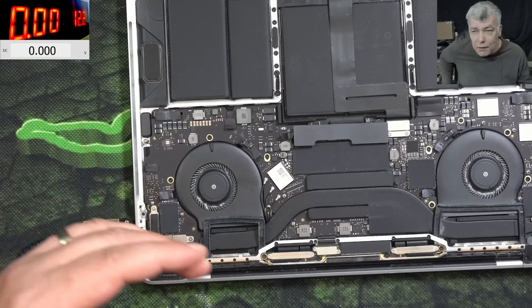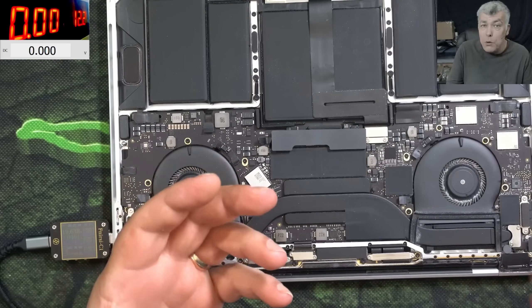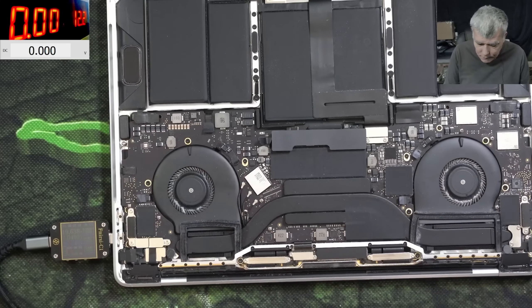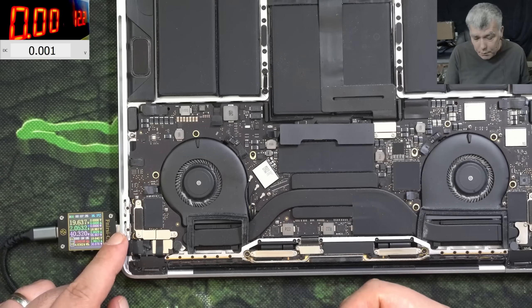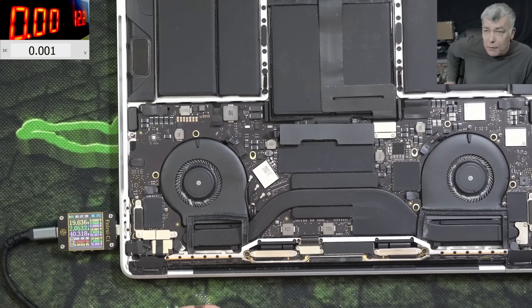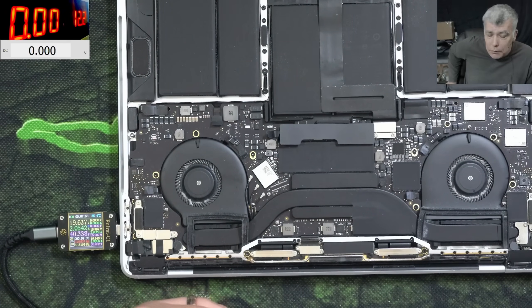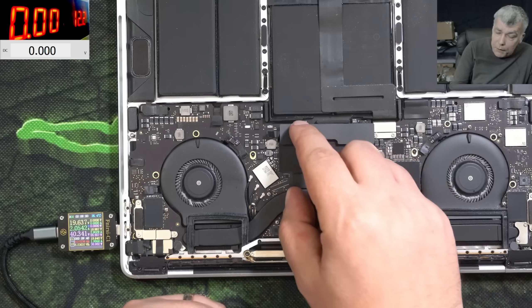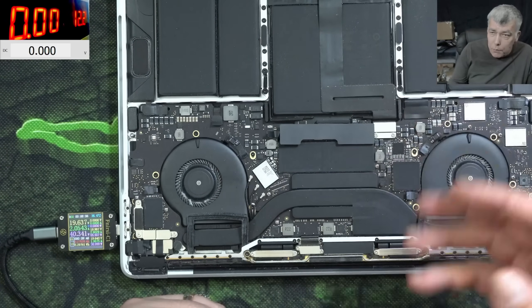We're taking the battery out of this discussion, because a used battery doesn't mean it's a shorted battery or one whose resistance you can check from here. If I take out the USB-C connector I can't even check the resistance of the main power rail because now the battery has voltage. The cells definitely have under 1 ohm, but you cannot check the resistance from here because there are MOSFETs in series. Most likely the battery was disconnected by the MOSFETs because that's what the power management chip does — it disconnects the cells completely to prevent further damage.